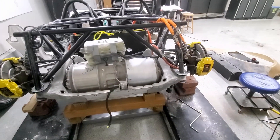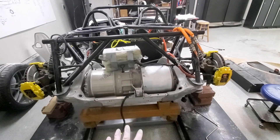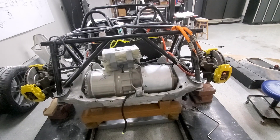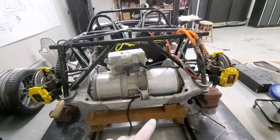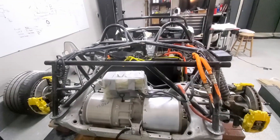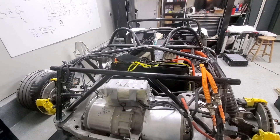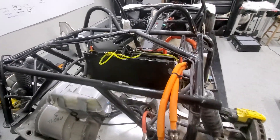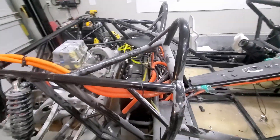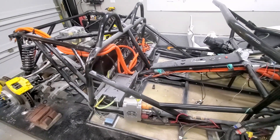I've got my jig out here to support the motor. We're going to drop the subframe and hoist the motor up to get enough clearance to take off the inverter housing and swap the board. We won't reassemble everything until we do a test to make sure the motor spins and everything's talking and working. Once that's confirmed, we'll reassemble. If we get Pack 2 working, we'll clean everything up, make sure everything's exactly how we like it, and put the shell on for good. I'm also going to redo some of the coolant lines — some are a little kinked. Everything is quite dusty from all the fiberglass work, so we'll clean that up too.